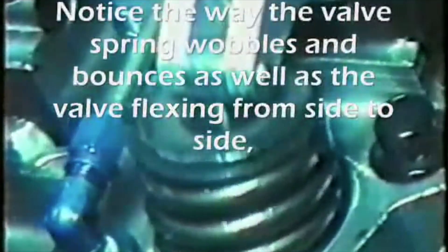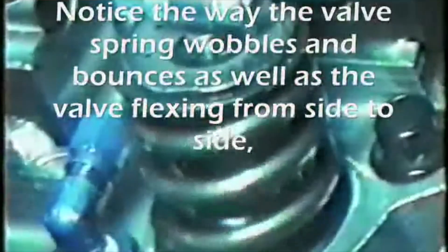You could be losing valve lift, bending the push rod, wearing holes where you don't want wear. You'll see a wear mark in the cylinder head where the push rod goes through, and it's an eighth of an inch away from the wall — you wonder how that happened. He said they ordered push rods from Manton, Comp Cams, and others — half-inch, seven-sixteenths, thin wall, thick wall — they tried all kinds.